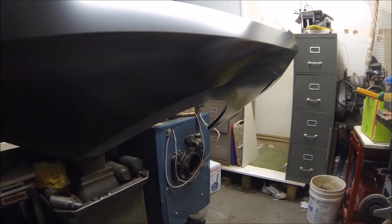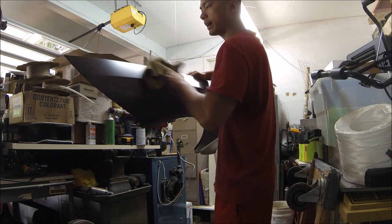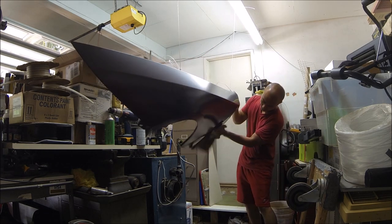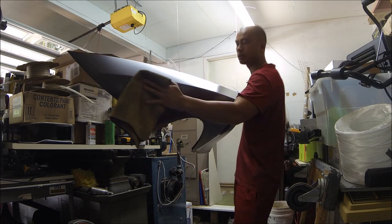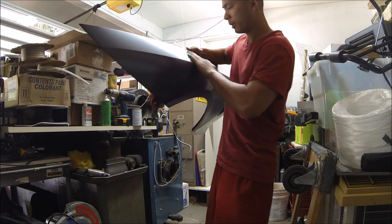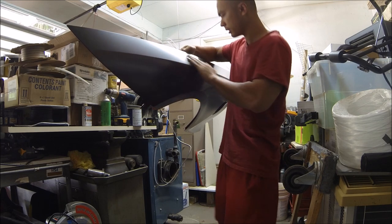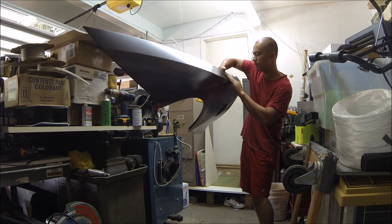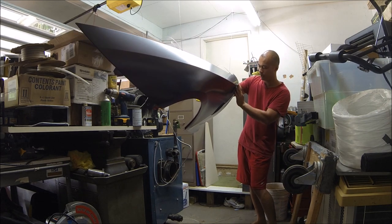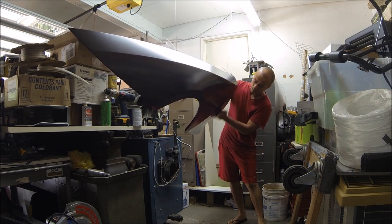The first thing I'm going to do is wipe down the fender completely. It's already primered in black, so after wiping it down I'll scuff it up with a scotch-brite pad and then start putting on the base coat. I am definitely not a professional, and some of the techniques you see me do — I'm sure people are going to call me out and say I did this wrong or that wrong. But that's part of making YouTube videos.